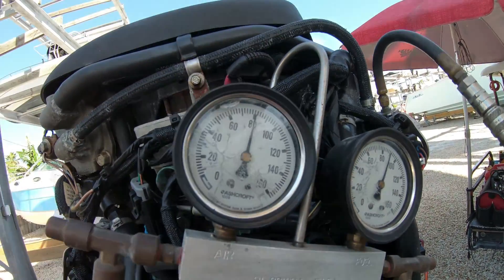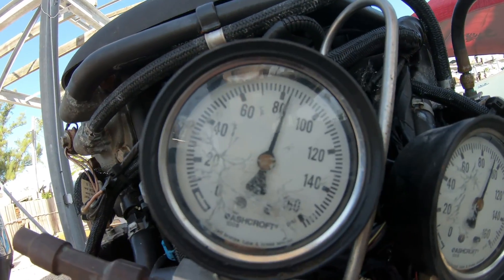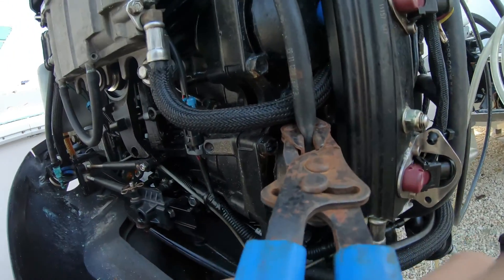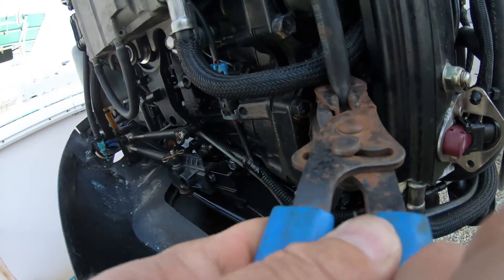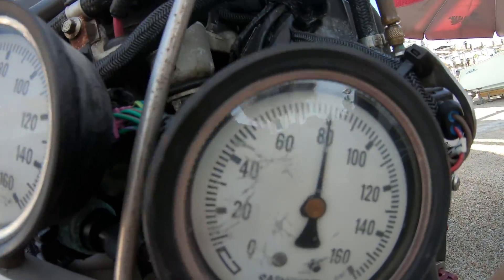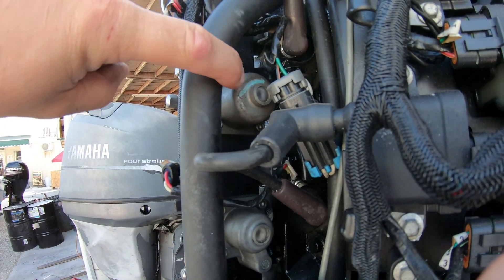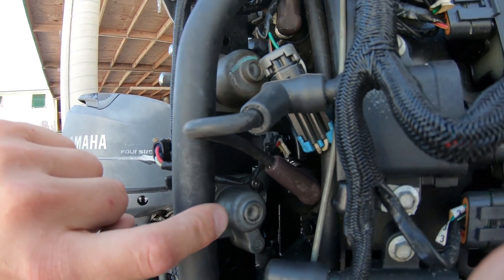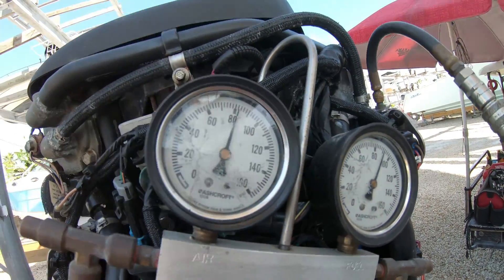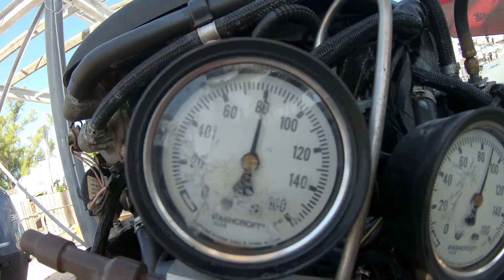Like on this engine, if the air doesn't jump, this usually indicates a weak air compressor. Air compressors are not cheap, and you definitely want to get a professional to double check your diagnosis before spending the money and replacing it. It is important to understand that the fuel pressure is a little trickier, because if the engine does not have the correct air pressure, then it will not produce the fuel pressure. Note also that there are fuel and air regulators on the port rail that regulate these pressures. If the spring or one of these fails, it can also cause the air pressure not to spike. Even a stuck open air injector can cause you issues and a misdiagnosis of the compressor, so make sure you know what the problem is before buying an air compressor.